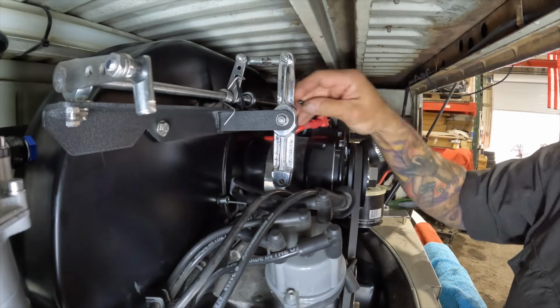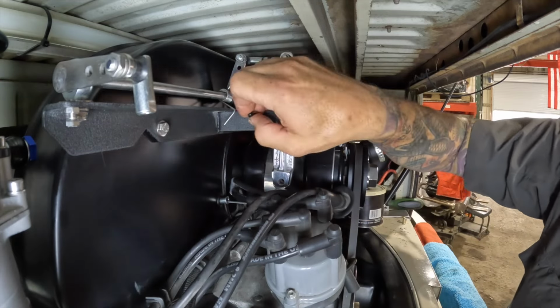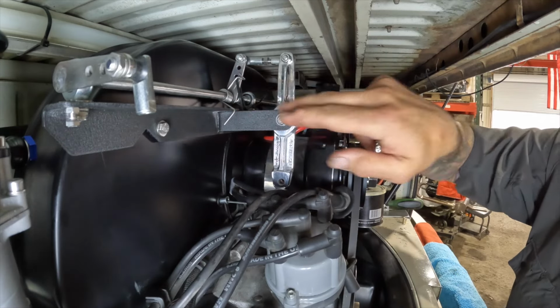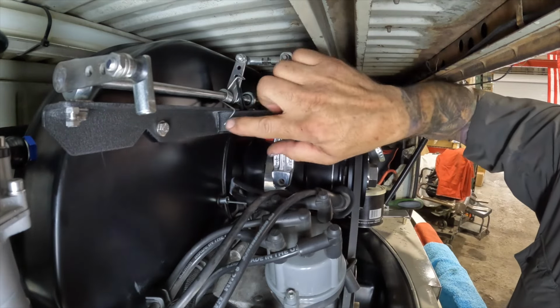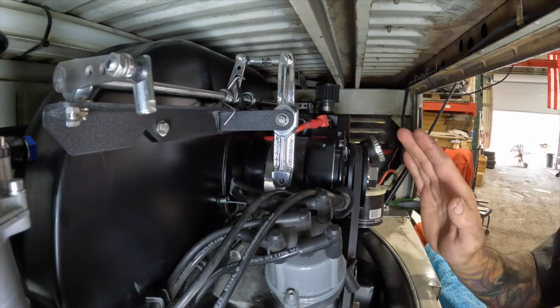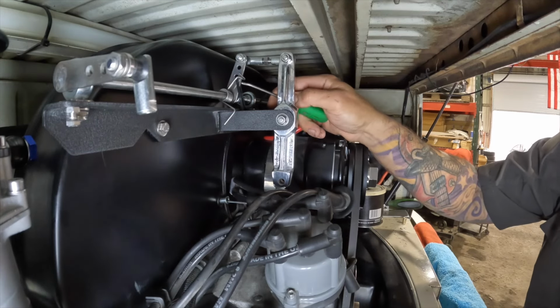The second spring I take off. I take a small little vacuum cap, and I go over the end of that so that it doesn't continue to scratch the fan shroud. And if needed, I will use the second spring, but if you set your linkage up properly, you should only need the one spring to do your return, and it gives you a really nice light pedal. Makes the motor feel responsive when you don't have to really lay into it to get it to do something. So I am going to pull this one off of here,